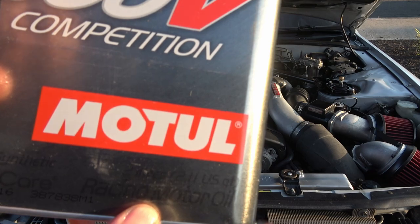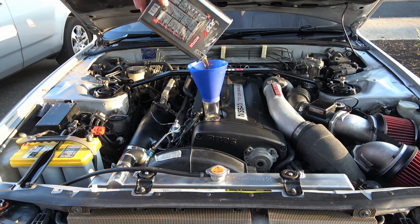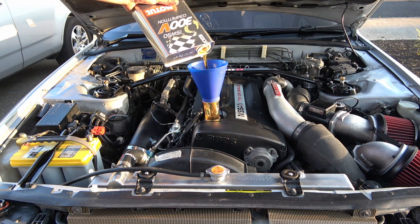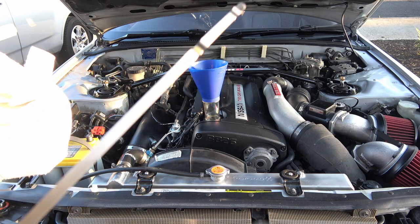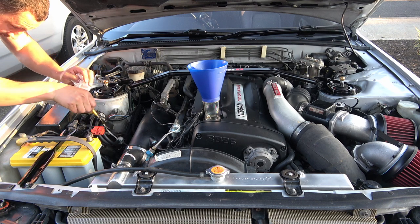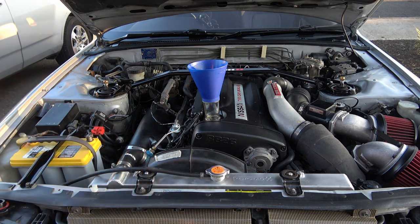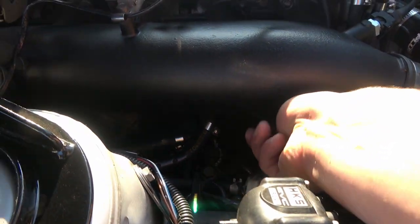You can see these are 2.11 US quarts each, so that's 4.2 quarts total — we're supposed to have 4.6 total. I'm thinking that's about right. I'm going to check it with my dipstick and start it, let the engine run for a bit to let the oil circulate up through the head and back down into the pan. We're barely registering on low still, so I backed the car down off the driveway onto level ground to check the dipstick.